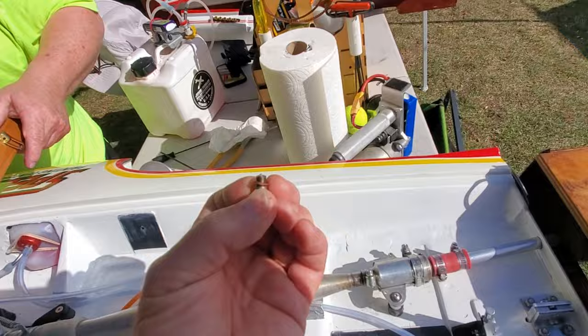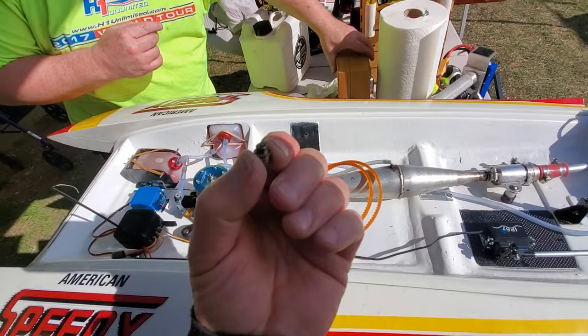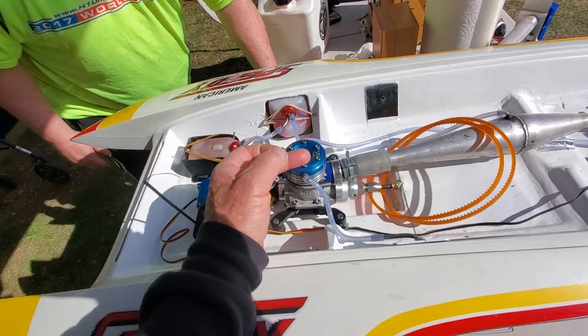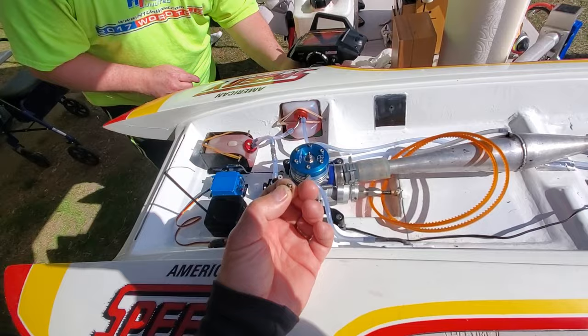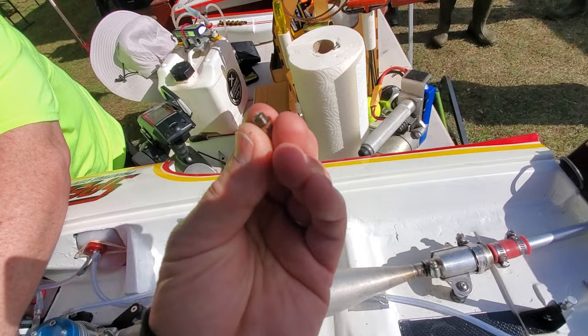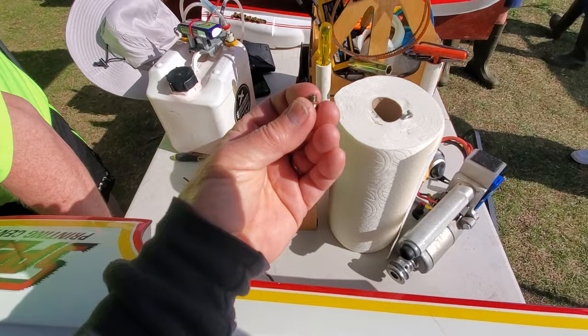When you see the coil inside start to pull out, okay, you've got your pipe length perfect and your fuel mix perfect, because that means that pipe is sucking hard and that jams more fuel in. I don't want to say a supercharger, but it almost behaves like that. It's like a reverse turbocharger, where you're literally sucking that fuel in super fast, and it's sucking hard on that wire and pulls it out. He's nearing the danger zone here, but that's a final setup there for sure. Then your boat comes across the start finish line, and as soon as you let go of the throttle, it dies because your plug burns out. But I set it right on top of that.